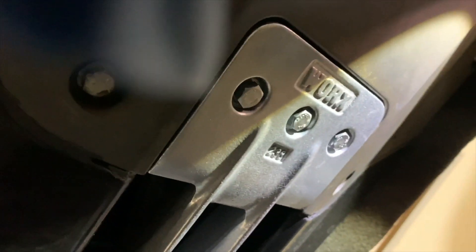This shows you how tight a spot I can barely film in, but this is what it looks like installed. When you install this, make sure to periodically check the bolts and tighten them because they can come loose — you should be doing that even on your OEM system, but it does say that in the install instructions and it's a crucial thing. I got them pretty snug — you don't want to tighten them so tight they break, but you don't want them loose. After the next ride I'll check them again, and after a month or two I'll check again. The bolts in the back of the intake grate are not that long; the front one is super long, the others are really short. It's smart to just keep checking those and making sure they're not coming loose.